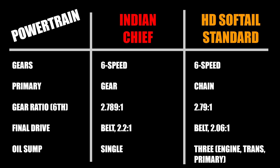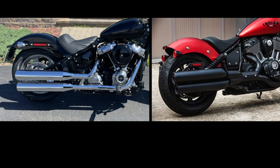Transmission gear ratios are very comparable with identical top gear ratios, though Indian's first gear is slightly lower. Both bikes use final belt drive to get power to the rear tire. When it comes to maintenance, Indian's oil system is single sump, meaning one oil filter and one oil cavity services the engine, transmission, and primary, where on the Harley they still use three separate oil systems. This, along with the jiffy stand, are a couple of the items I really wish Harley would update. Exhaust is very similar, with both bikes using 2x2 shotgun-style exhaust on the right side of the bike, with a crossover pipe just before the mufflers.